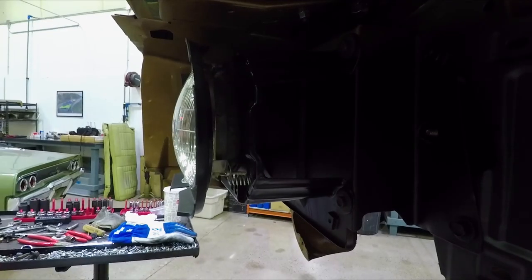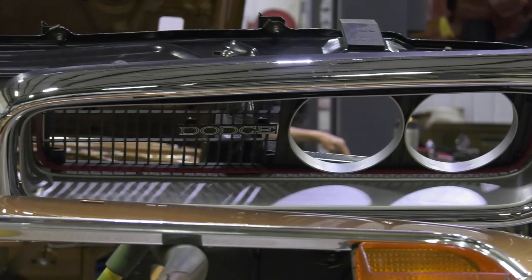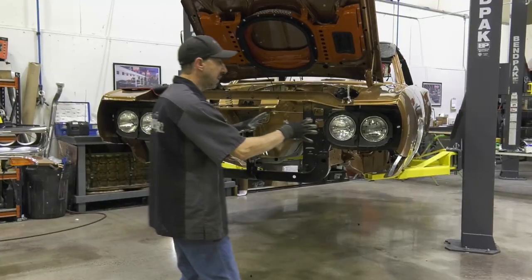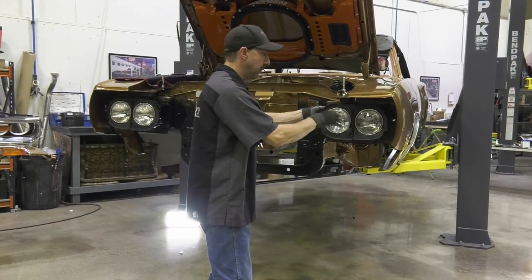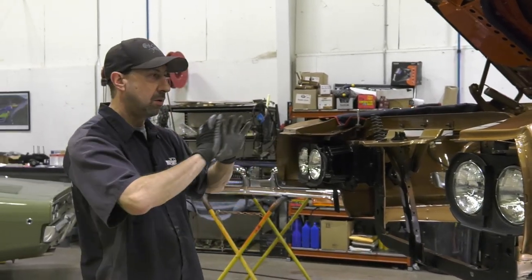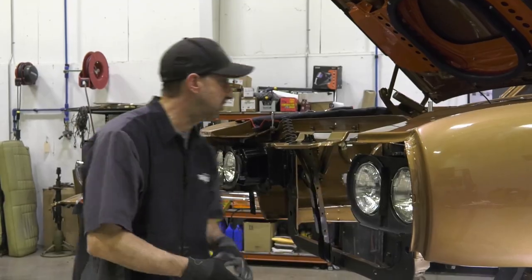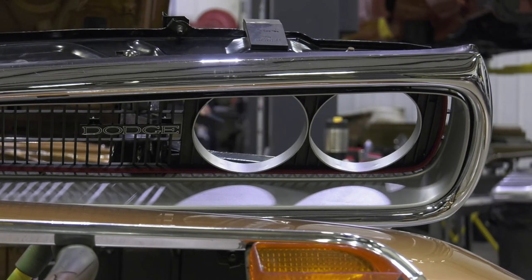I'm going to put on the front bumper and grill assembly. It's all built out — I detailed everything, cleaned it, made sure it had the right bolts. I've got the headlight assemblies in here, and they're a little bit loose, just sitting in there. Once I get that grill surround in, all the headlight buckets are built into the actual grill. Then I can align them to match up with the holes in the grill, tighten those down, and everything will be finished off.